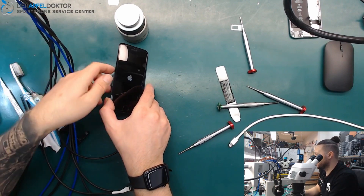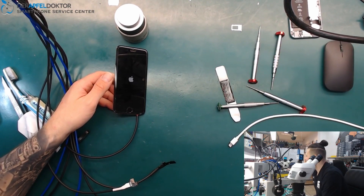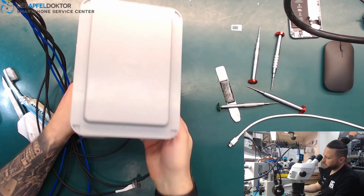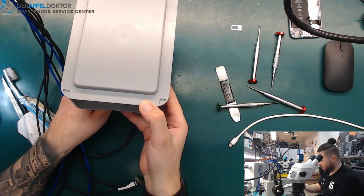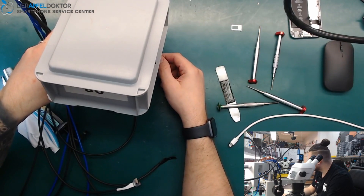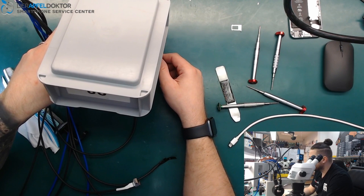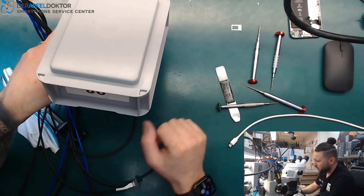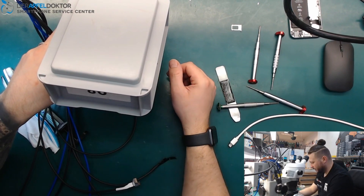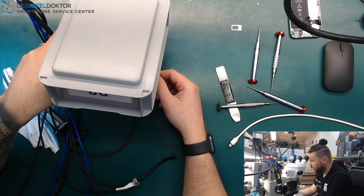Boom — we are back to life again with our iPhone 6 after just a little short on VCC main, solved by using the amazing ICC Pro. I just want to wait until the device has fully booted up so I can check if there are any personal images on the screen, and after that I'll show you the device is working again.